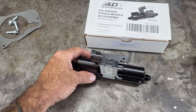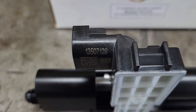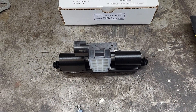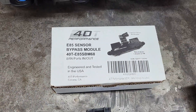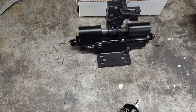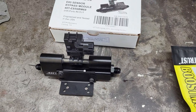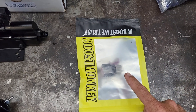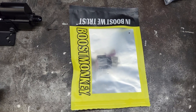This is a standard GM AC Delco flex fuel sensor with part number 135-07-128. It's the 95mm overall length. Works just fine, bolted right together. This is from 40T Performance out of California. It's the same as some of the other brands out there, but I liked it so I got it. I went ahead and found a plug for the flex fuel sensor pins from Boost Monkey — I believe I got it on Amazon.